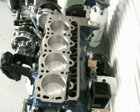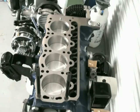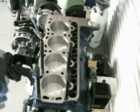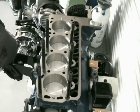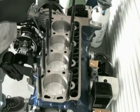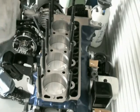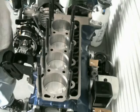Just put the oil drive shaft in there. Another thing is you must put that in before the head goes on. Unfortunately in a 3TGTE that little shaft does not come off if the head is on — it fouls under the bottom of the head. So it's probably an easy mistake to make, but don't make that mistake; make sure it's in before you put the head on.